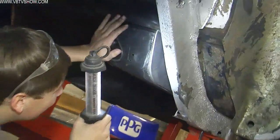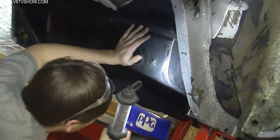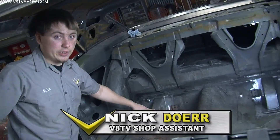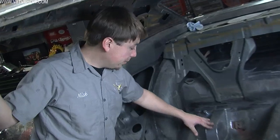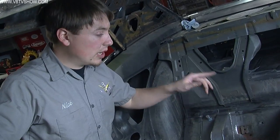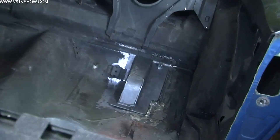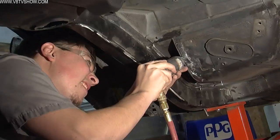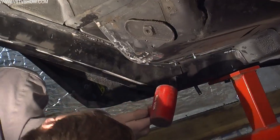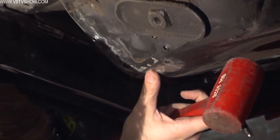The next step is to secure these pockets to the Camaro floor for welding. In our case, we used some sheet metal screws to get everything tight to the floor. But fabricator Nick found that one of the parts of the floor didn't quite fit as well as the other. So at this point, we've already cut the holes in the floor for the Detroit Speed upper link pockets. I have the passenger side screwed in because the floor meets up with the pocket pretty well. The driver's side, however, needs a little bit of metal work to get the floor to meet the pocket. It's important to have those pockets screwed or clamped or somehow attached securely to the floor of the car so that when you go through your plug weld operation, there's no gap between the pocket and the floor.